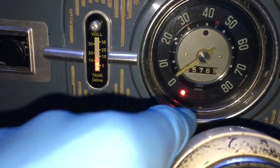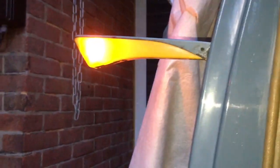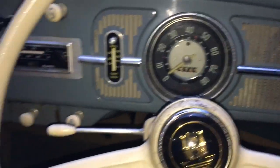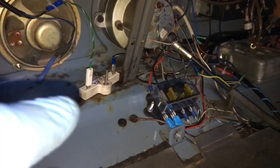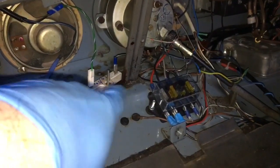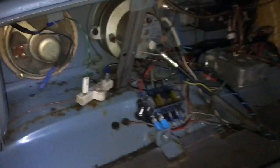With the ignition, one light comes on as the dash gauges are down. That semaphore pops up absolutely at normal speed — driving along on a cold day, it'll pop right up with the flashing 6-volt bulbs in there. The other side, running on the old ceramic unit, is a tad slower. Once both have been replaced with the 1-ohm resistors, they should operate at the same speed. Mount the resistors to a rectangular piece of aluminium for a proper, neat installation.